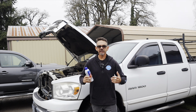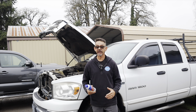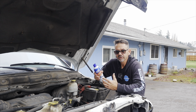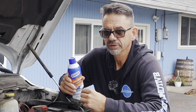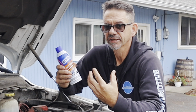You may be fighting electrical gremlins in your car, so in today's video I'm going to show you some steps that you could possibly take to rectify those problems, and it's not going to cost you a lot of money. A big problem on today's vehicles is voltage drop, which occurs when there's corrosion, gunk, grease, or grime built up on electrical connectors that doesn't allow the proper amount of voltage to go through.